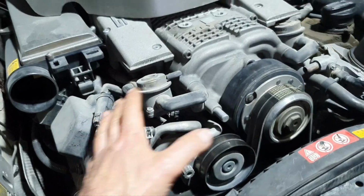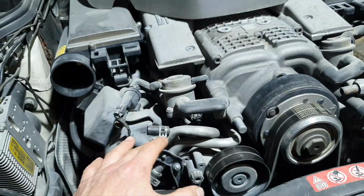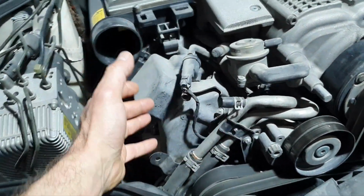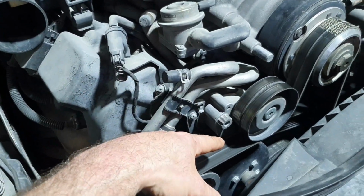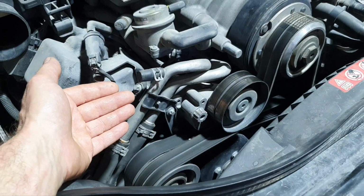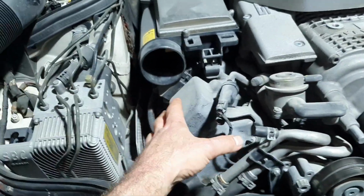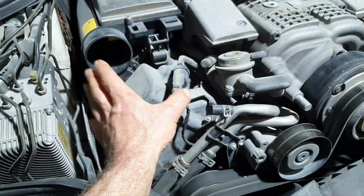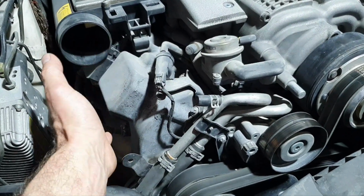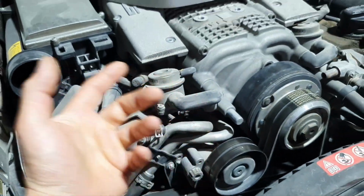Even if it's a head gasket, even let us say that it has a blown head gasket, all right? And in one way or the other, it's leaking inside of the oil pan. Fine. With all this contamination, to change the O-rings and the O-ring for the oil pickup tube and to open the oil pan, it's a must. That means you're not just going to open only the head gasket, the cylinder heads, change the two head gaskets and then close everything again. It's not like that, obviously. You're going to change the seals, you're going to make sure that everything is okay. You're going to open it once and you're not going to have any headache.